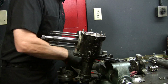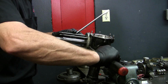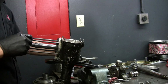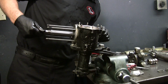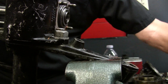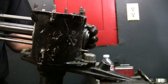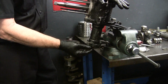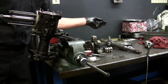Okay, now this is the part where it gets a little dicey. This sleeve is hard to get out. What I was looking for, the centering for this worm gear, is this right here. There's a washer in there, and that's what I was looking for. This washer just doesn't seem to come with this box. It's a different diameter, everything. There is one more washer down here that sets the preload under the bearing, but it's really big. So this is not of this world.